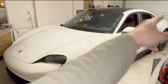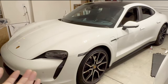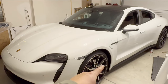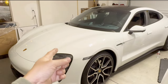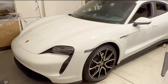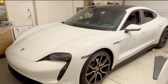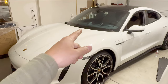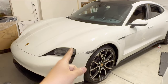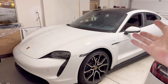There are six drain plugs total that you can take out very easily — very accessible — just to do maintenance and prevent future battery failure. If your high voltage battery is sitting in a puddle of water inside and it's not draining, water is going to cause damage. And obviously it's an electrical system — even though it's sealed, who knows what will happen. I think that's why it causes those issues. If you visit any Taycan forum that's all they talk about: car stopped, had to take it to the dealership for two to nine months to replace the entire battery.